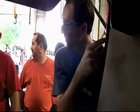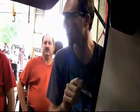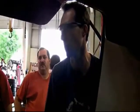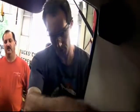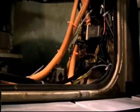In the front of the car, there's a circuit breaker with a manual disconnect, so you can manually shut off the electricity. In the event of an overload, it will automatically shut off the electricity. That's mounted in a box just to the rear of the charger, between the two seats. From that main disconnect, the wire comes back through the passenger compartment and into the contactor, which is the main power supply to the controller.